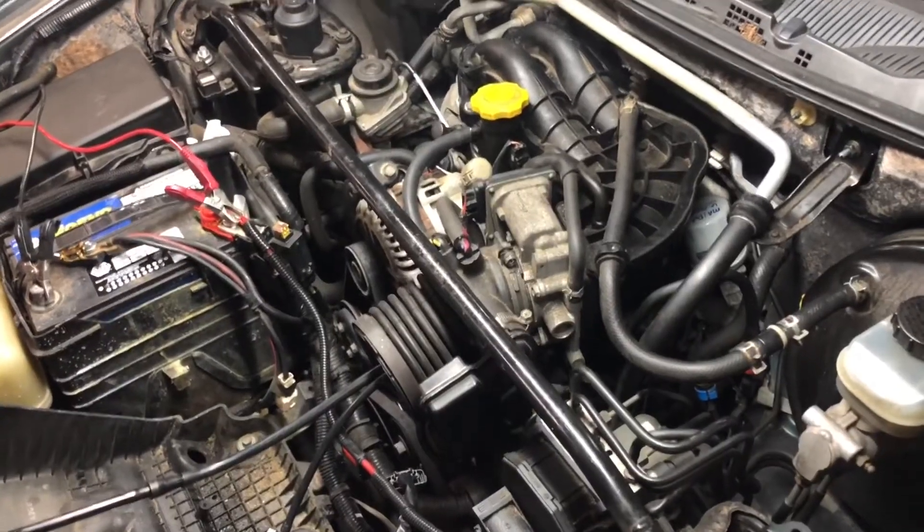I also want to speak a little about the starting issue. I've noticed oil in my air box — I didn't notice it before since I just got this RX-8 and that was the first time I checked. I've seen some cars where the bottom of the air box is like a quarter inch full of engine oil. I don't have that, but I noticed towards the top of my air box there's about a three-inch diameter circle of oil — and it looks like clean oil.